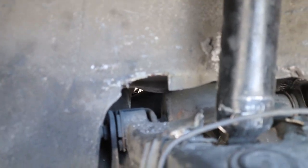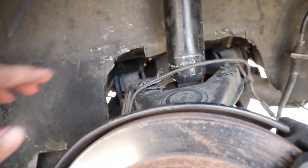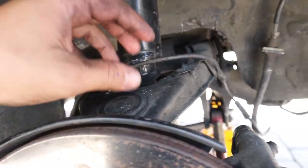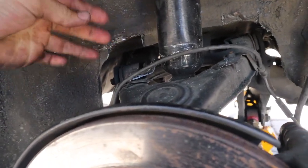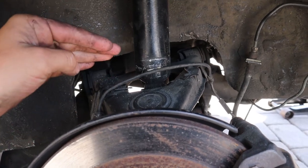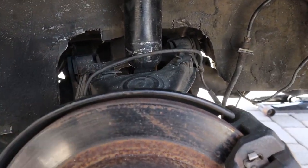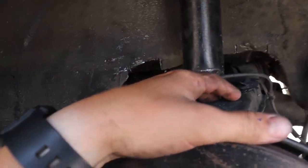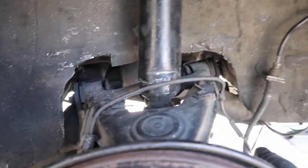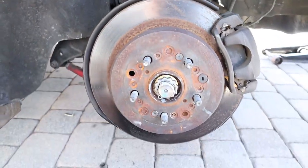After a couple minutes of cutting, we now have the tiny little notch. I brought it all the way up until you see the floor inside — it's basically just part of the trunk. I'd say that's a solid inch up, which will give me an extra inch lower. Being that these are stock upper control arms compared to Serial 9, T-Demand, Nagisa, or really any of the brands that make aftermarket control arms — they bring them out and bring the ball joint up and angled a bit to help with ball joint angle with a lot of camber. But of course being OEM, these are basically going to be straight. So if I had Serial 9 or some other upper control arms, maybe I'd be able to go a little bit lower. I'm going to do this side and then start on the other side, put the wheels on and the coilover, and see if it really made a difference.